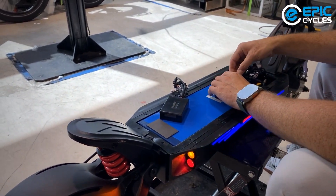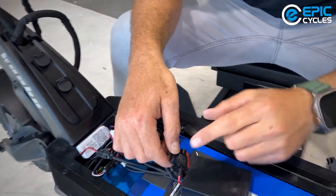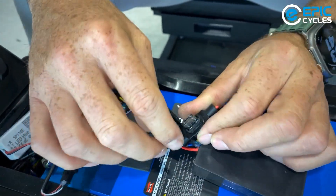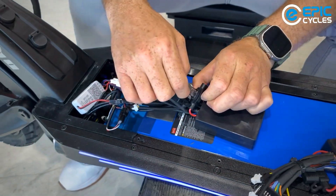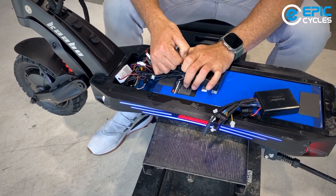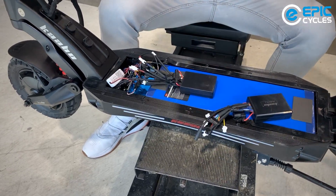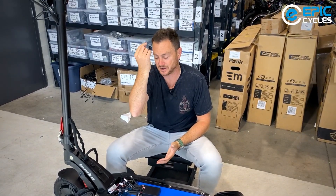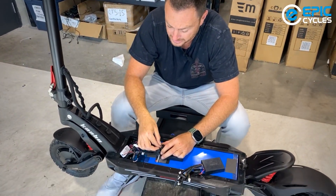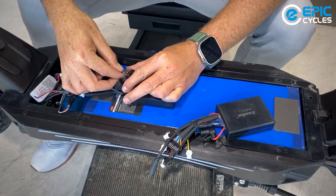Another thing to mention: before you replace your light module, you may want to check your fuse — maybe your fuse blew. You can open it. It's a simple two amp fuse. You can check it simply by removing it to make sure nothing's broken. It's a very cheap part that you can find in most hardware stores or Canadian Tire. As soon as I remove the fuse, all lights are done — they're dead. So it could be as simple as a little fuse. The fuse for the light module is right here — we're going to plug this back in.